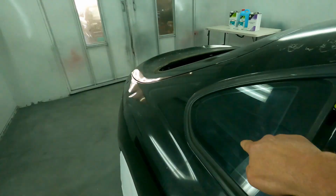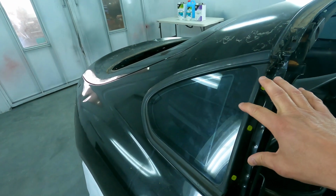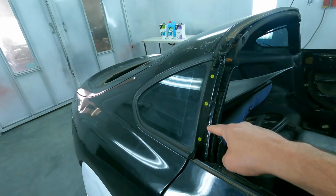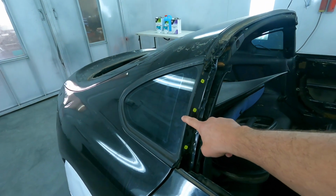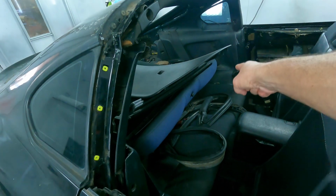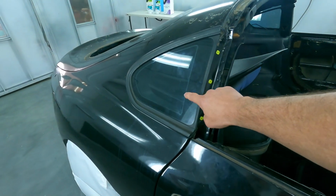Now on this car, windshields are still available, so we're going to install a brand new windshield. The quarter window glass, we actually acquired brand new OEM, so we're excited about that. This quarter glass is weathered and has original rubbers around it, and the new quarter glass comes complete with the rubbers attached. So the fact that we were relying on a glass guy to remove this doesn't really matter, because these are getting replaced and will probably get tossed. But we had to wait to have him remove these because we have to remove these rear quarter panels before we unbolt these. These are a bolt-in item.